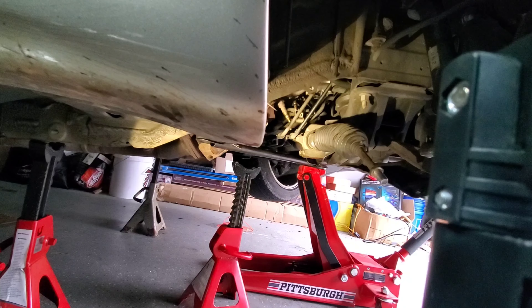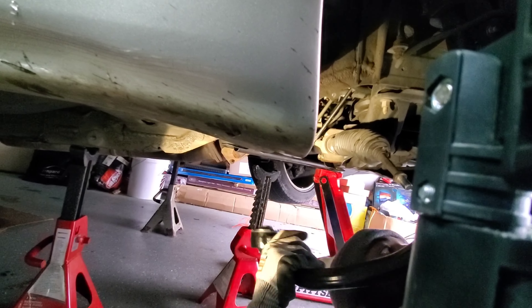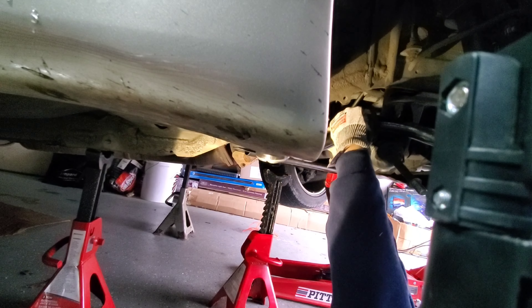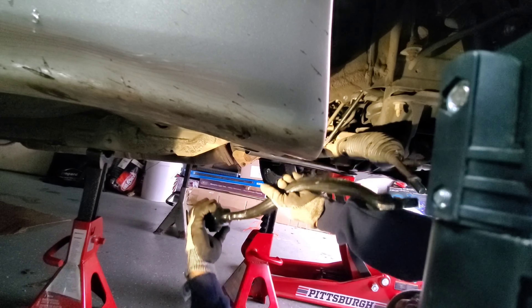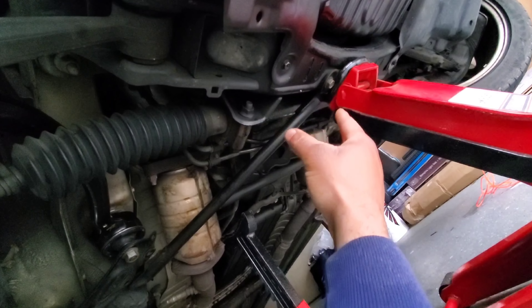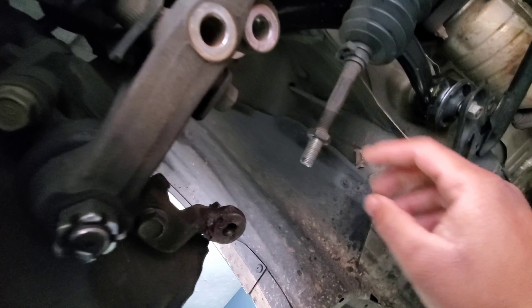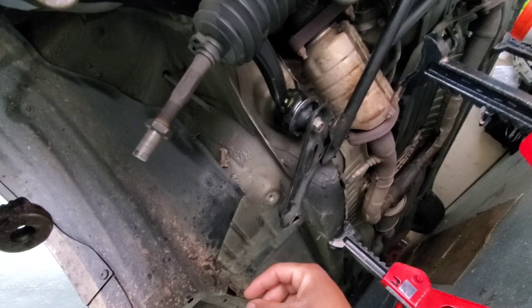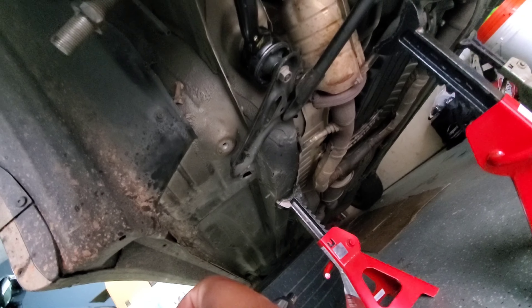Let's get this bad boy on. I'm trying to record the best I can for you guys. I took all the bolts out of this plate and also had to loosen this one up to kind of slide it in. These are stock parts — I haven't changed anything on this car. These are the two bolts I took out. I'm going to be putting everything back on with a little bit of Loctite — the breakable kind, the blue one. I think the factory had like a green Loctite on it.